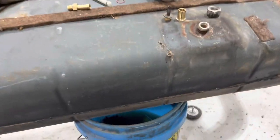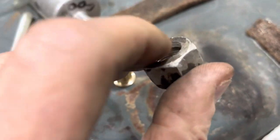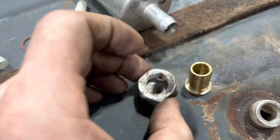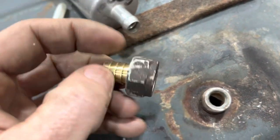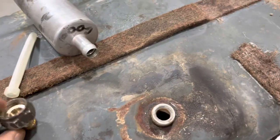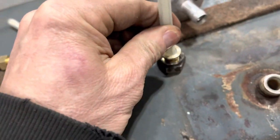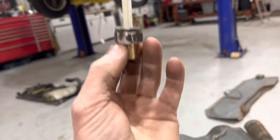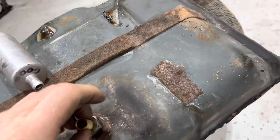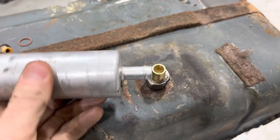For the final product here, we need better flow. I took a brass fitting, machined it down, and drilled out the hole larger. Instead of the small setup going on the gas tank, we now have this setup which also includes an inline strainer filter that plunges in — counter-bored a hole. Now this whole assembly can go in the gas tank. This is upside down — it'll be screwed up on the bottom of the bus. I'll tighten this down and put a hose on here to feed the pump. These are both half inch.